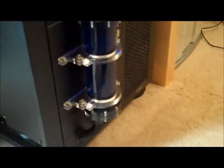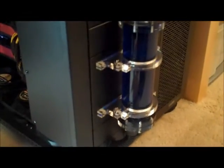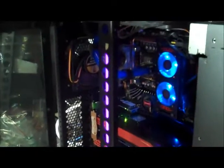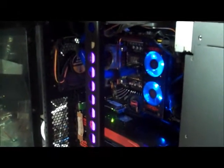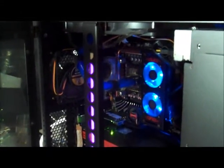Some of the things I'm going to try is putting some clips onto the hoses, because it's a very pliable hose. I'll put some clips onto the hose where I take off the CPU water block, and I'll try to disconnect those over a towel so it just drains out a little bit of the fluid. And then I'll reroute the other lines before unhooking the clips, because I want to try to avoid draining the entire system. But unfortunately, I think I may have to drain most of it to replace the graphics card. But I'll tinker around with it and find the best way to do it with making the least amount of mess. And once I get that underway, I'll start the video again.